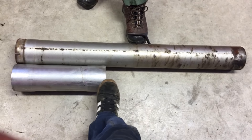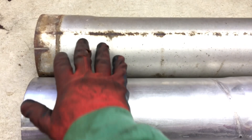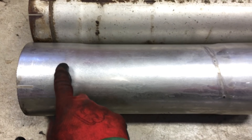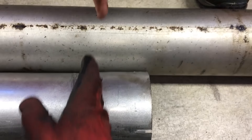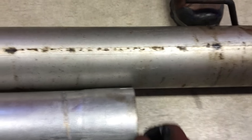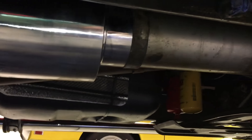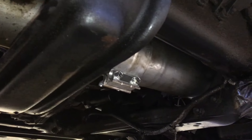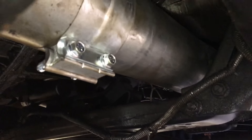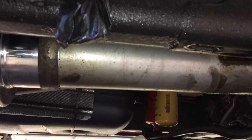This longer piece of straight pipe was the piece that was just behind the downpipe. So what we're going to do is take our resonator — since it's already got the flange end on this side, we'll butt this onto the downpipe. And then all we have to do is make a single cut here, and this will slide onto the old straight pipe. Here's a quick shot of the new MBRP QuietTone muffler. At the front of the straight pipe is where we put the resonator right there, and then it goes up to the downpipe.